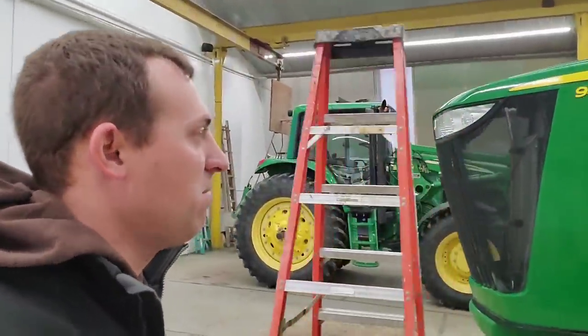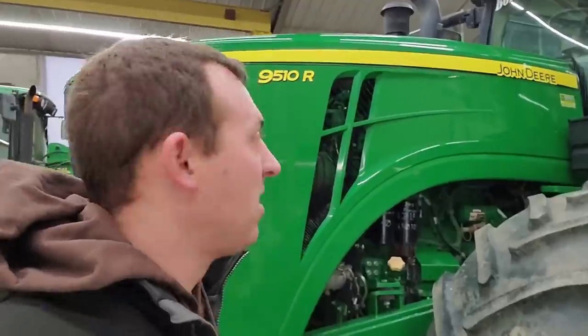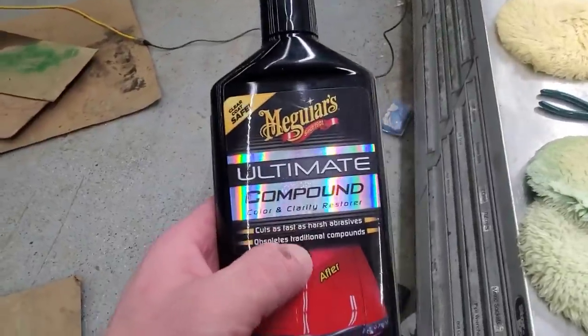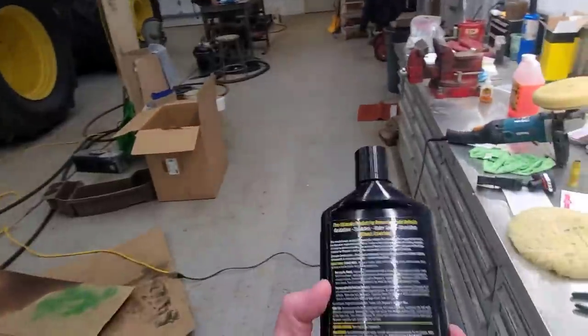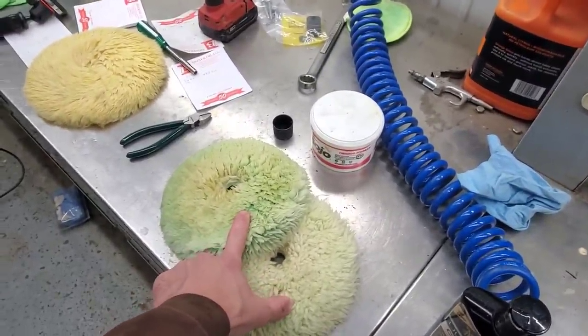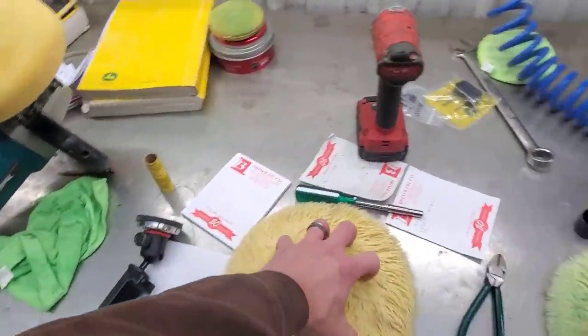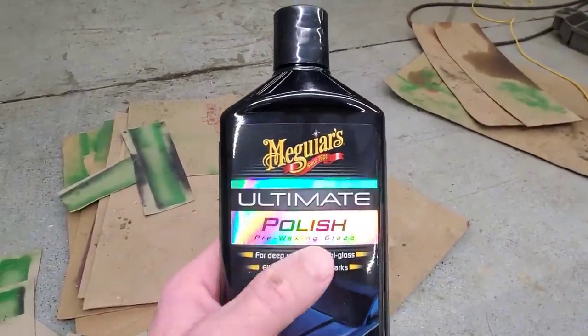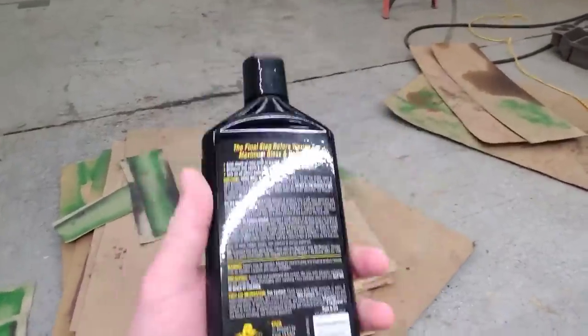She still looks really good, nice and shined up from what we did last Wednesday. We're gonna go over it again with another polishing compound and then get our ceramic coating put on. Last week we were using Meguiar's Ultimate Compound — it worked pretty well, but the directions say to use something more aggressive. These are wool buffing pads for our Makita rotary buffer. There's also a cotton one, which is more of a polish than the wool ones.